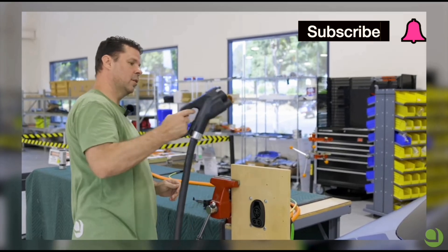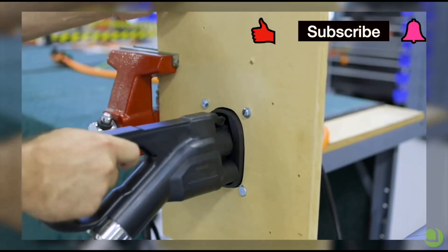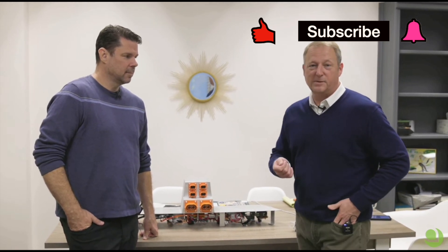Now to the explanation. You may recall from Chris's campaign earlier this year to lobby Tesla to release their NACS plug for public use. Before that was done, the only option Aptera had was the SAE combo plug — a very big plug, a very difficult problem to package on the vehicle. That's why we always wanted the Tesla plug. Because we didn't have line of sight for that, and because we didn't want to package that big combo connector, we paused the development.